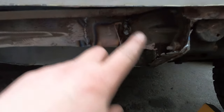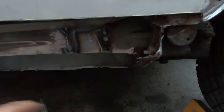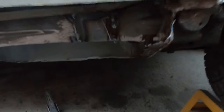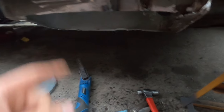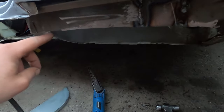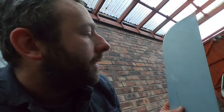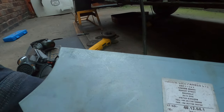And voila — the piece of steel that was missing from there, I've put that in. It's basically up-welding with no gas for the wind, but that's a nice weld up there and I've welded it all the way along the top. So this is all solid again now where all the subframe connects up. All we'll do is make a flange to come down here. We'll just get this trimmed up first to go in there — like I say, we're not using most of this panel. But that's that bit done, that's solid. So all the front's now ready for prep for the floor. The back's now got the bit of inner sill that I want to keep, so I'm going to bring the new floor pan up to this section to keep all this structure and not disturb the door bin area.